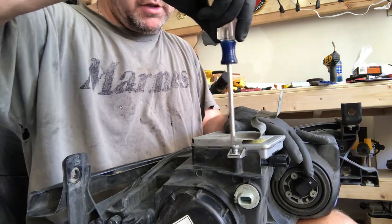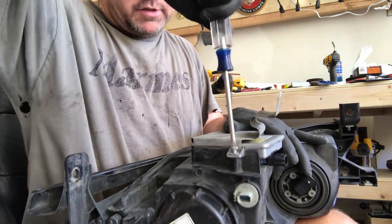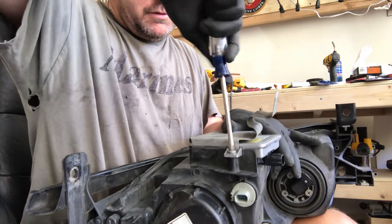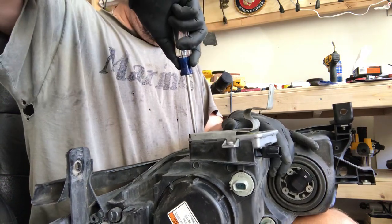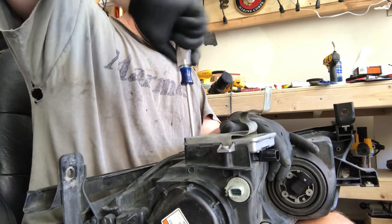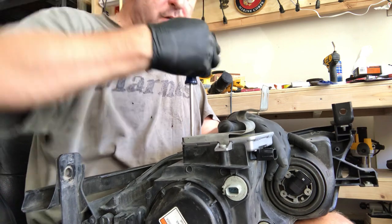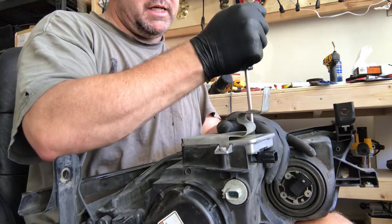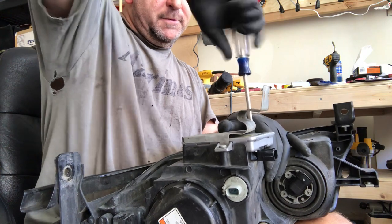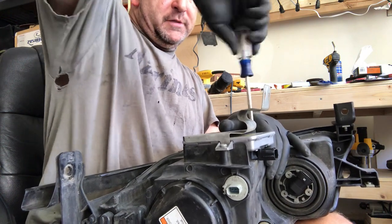Hopefully these work, because I've been having trouble with my right side headlight blowing out. So I looked it up on the Acura message board and people always say it's either the ballast or the igniter cable — because I highly doubt that I'm getting lemon light bulbs all the time. So hopefully this fixes it.